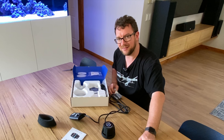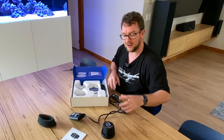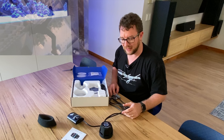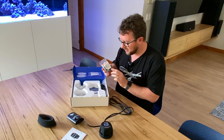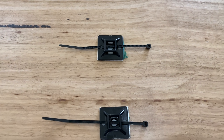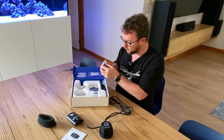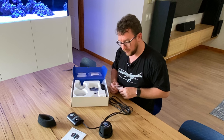Here are some important parts: little sticky tabs and dry side brackets which just help hold the dry side in place. One thing you need to be very careful of with the MP60 or any of the Vortec pumps is that if someone bumps the dry side, or something strong obstructs the wet side, you can actually dislodge the magnetic coupling — and these things aren't exactly cheap. You don't want this falling six feet and crashing on a hard tiled floor, doing damage to the pump, the floor, or your foot. I highly recommend securing the pump with a zip tie and bracket, and they now include these little dry side supports so you can easily find where you had the pump located.